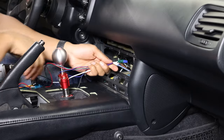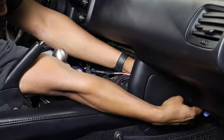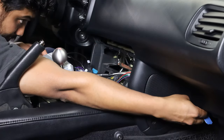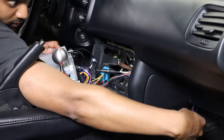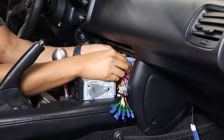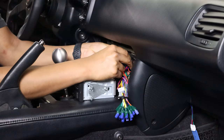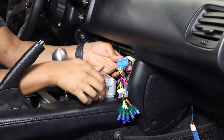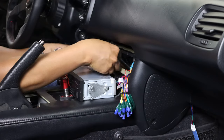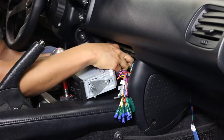When installing the new head unit, you're going to start by taking the DCI and passing it all the way through to the passenger side. Modify specifically recommends keeping the DCI away from the back of the head unit to avoid it getting pinched or overheated. I suggest placing it behind the passenger dash area. From here, we'll connect the main wiring harness, antenna, and the steering controls jack. Funny story — what you're seeing here was actually my second, maybe third attempt to get this in. Turns out, Modify forgot to send me the specific instructions for the Blaupunkt head unit, causing me to screw up the wiring. Luckily, my buddy Andrew Haik pointed me in the right direction and saved me from trying to figure this out by myself.